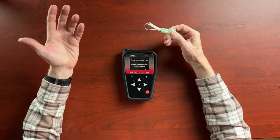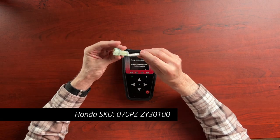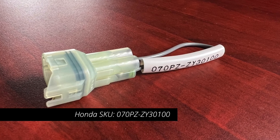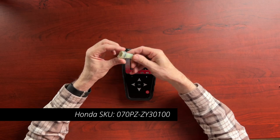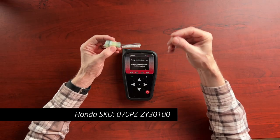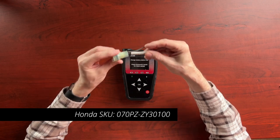You can do it yourself — it does require a couple of tools. The first thing you're going to need, or it's helpful to have, is this short connector from Honda. I'll put the part number on the screen so if you want to order this you can. You can get these through Wingstuff or CycleMax or from your Honda dealer. This is the same shorting connector you would use if you're going to reprogram a new smart key for your motorcycle. You could short it out with a jumper wire, but I think it's better to go ahead and have the tool.